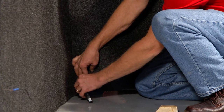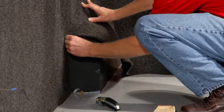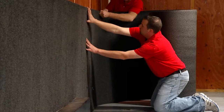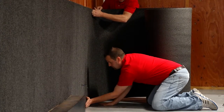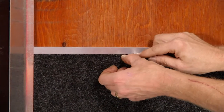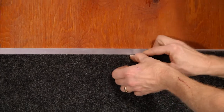If the trailer has wheel wells, carefully cut around them, allowing one inch of extra material to adjust the final fit after gluing. Repeat this same process, continuing around the trailer to install material on the front bulkhead and the opposite sidewall. With the wall covering complete, simply tuck the top edge of the TrailerWare material into the aluminum extrusion rails.